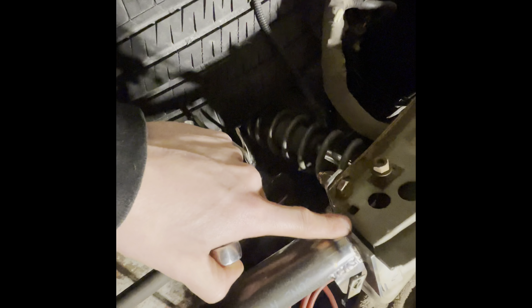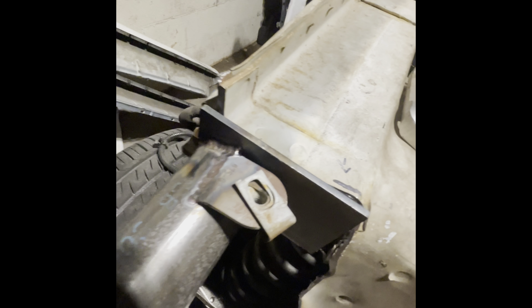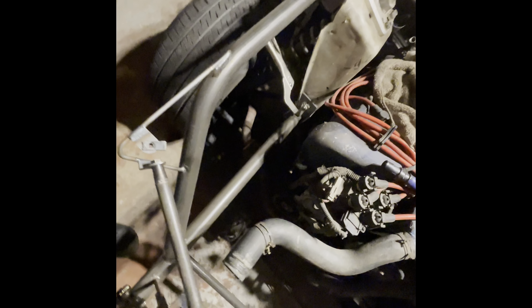This thing fits very, very well. As you can see, we have a very small gap here. We can easily fill that with weld. We have a perfect welding point right there and on this side also. I'm also going to fill this in with weld just to strengthen the strut tower back up a little bit. Down below we have very good gaps and everything, and I don't think that will be any issue whatsoever.